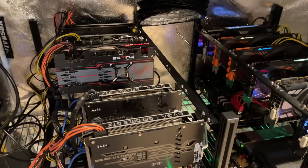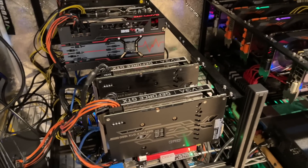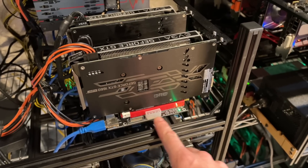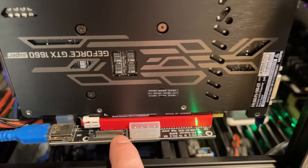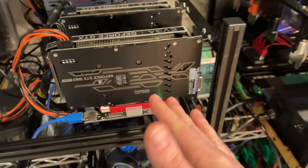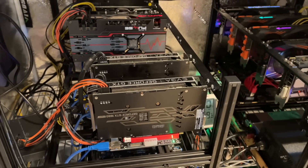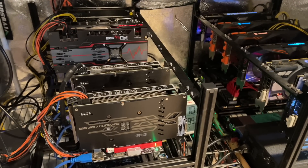When I started mining, this was a pretty confusing thing for me — while I had PCs in the past and had upgraded video cards, you'd just plug it into the motherboard and it takes care of everything. But now you're responsible because you have this riser. In the end: SATA — bad. PCIe — good. Molex — maybe. The best thing you can do to protect yourself, your rigs, and your investment is use PCIe — either multiple power supplies if you need it, or splitters if you can get good high-quality ones. Just be safe, guys.